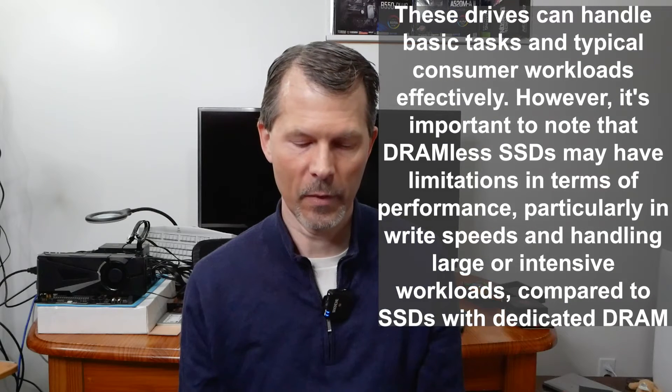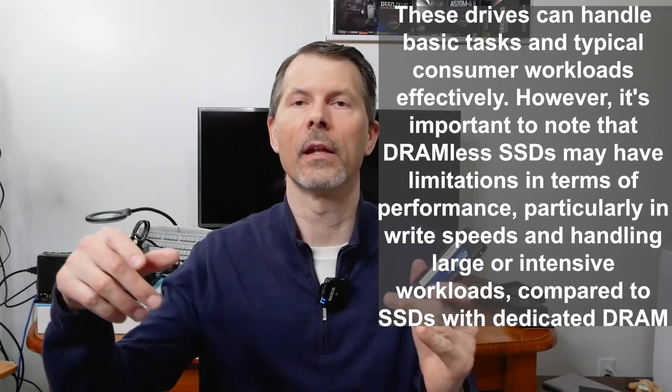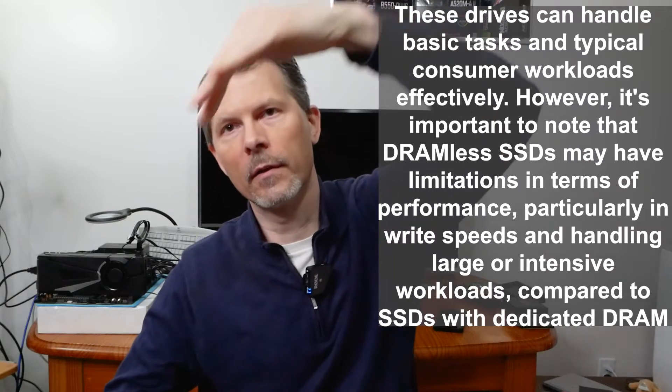The purpose of this video is to give you an overview of what the best bang for your buck drive would be. You might want to go for an NVMe drive if you have a newer system, because they can provide up to ten times the speed and throughput for read and write in some cases, and they might not have the same limitations where performance tanks after writing a certain amount of data. We'll come up with results and compare them.